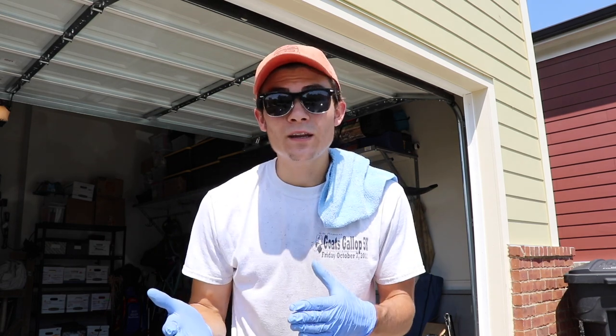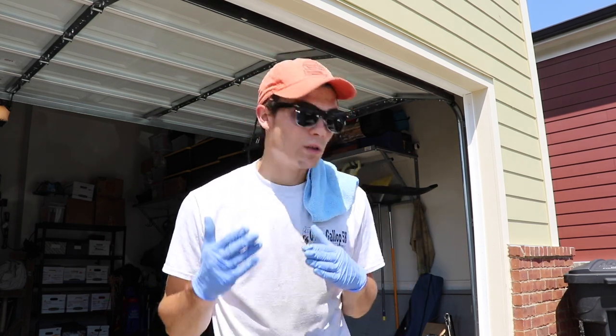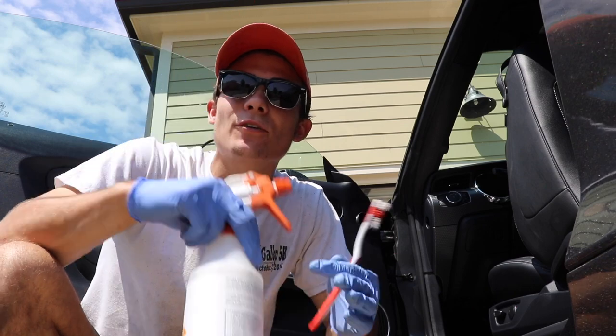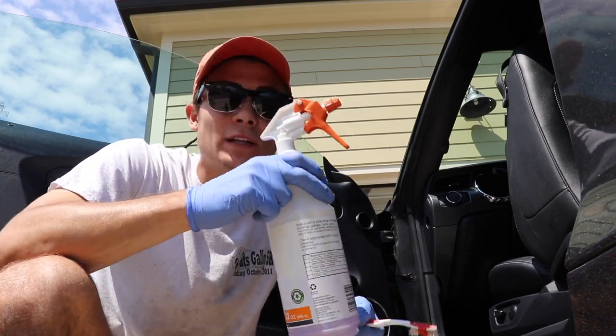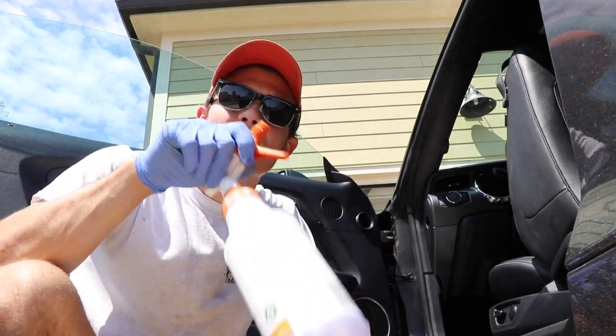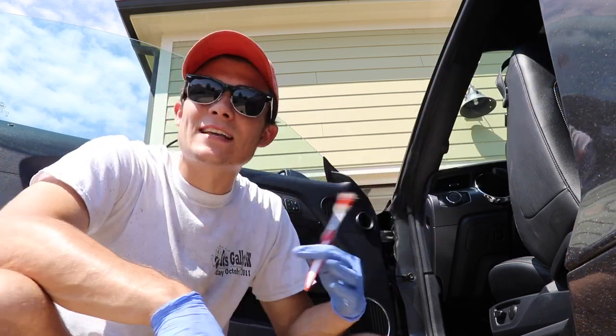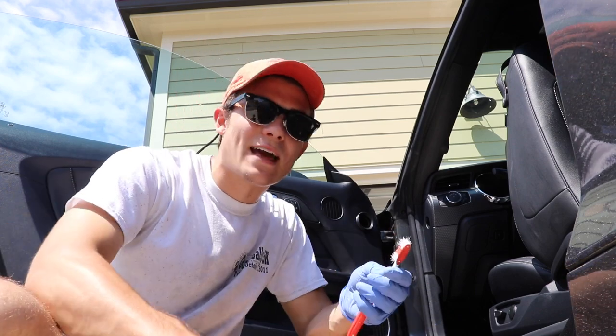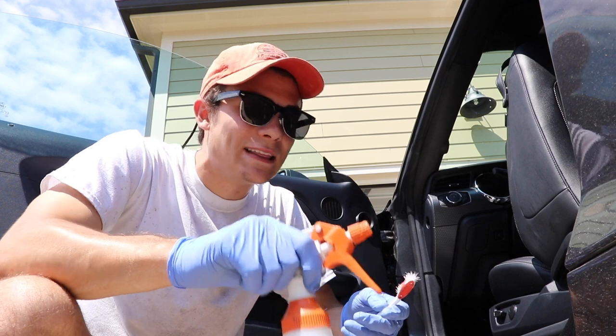That work can be avoided, and I'm going to show you guys the vehicle I'm detailing right now — a Mustang — and show you exactly how I attack the door jams with my Super Clean and my VX5000 steam cleaner. I have my Super Clean degreaser diluted five parts water, one part Super Clean, which is a much safer dilution for any painted surface. Just let common sense guide you — don't let it sit and dry on the door jam.